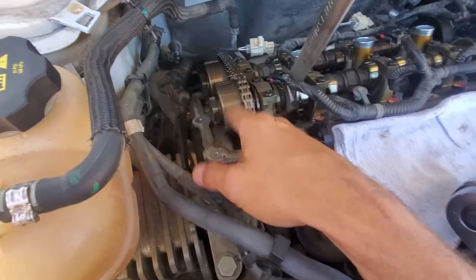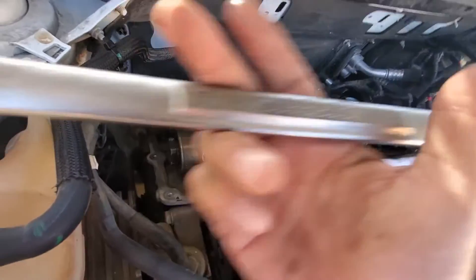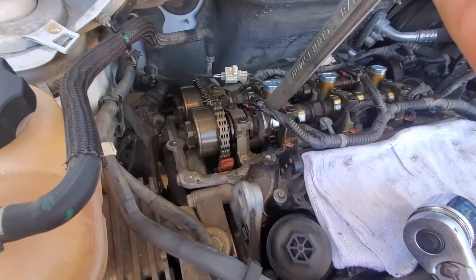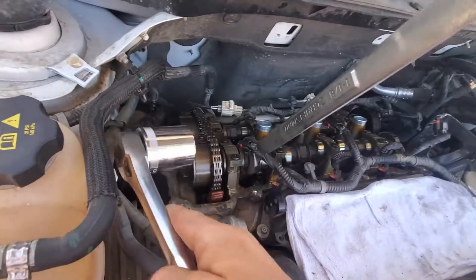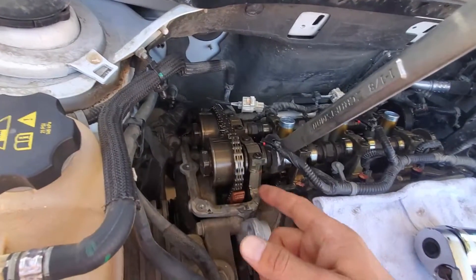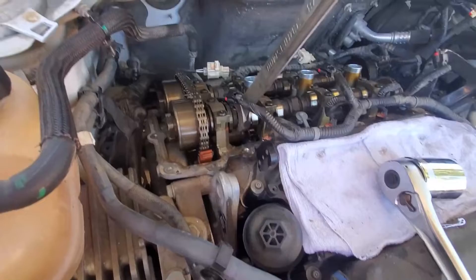The wedges are there as a secondary safety precaution. I've also used an inch and an eighth to hold on to the camshaft to keep it from turning or moving. It's a bit of a push and pull to get these guys to come loose. Once it's loose, we can start working on the caps for the cam itself.